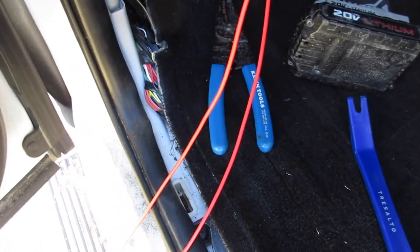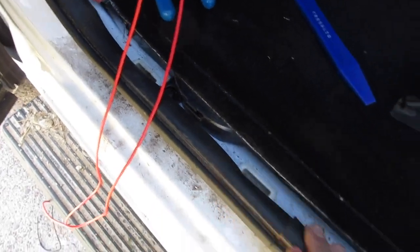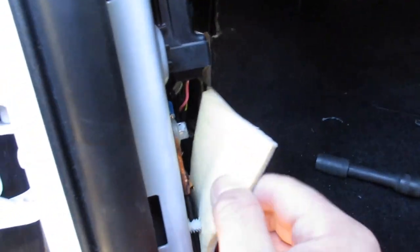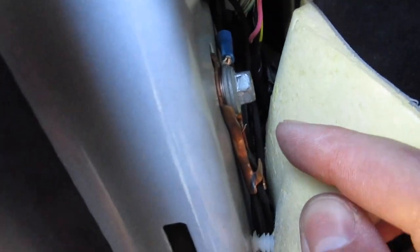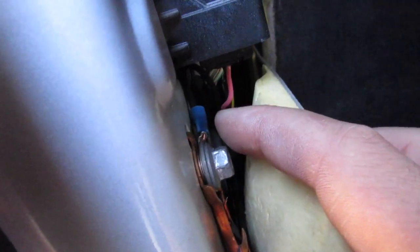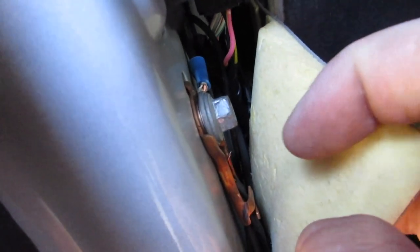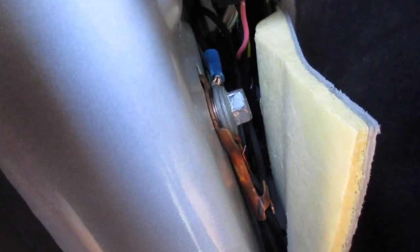Something I always like to do is, when you get real close around these wiring harnesses, sometimes under this plastic is hidden grounds. I just so happened to find one because I've never taken this plastic off. Right here is actually a stock ground that already has a nice bolt and washers there. So what I went ahead and did is tied the negative — you can see that blue right there, that is my negative wire. I put a little circular ring connector on, and it bolts right on, so now my negative is done. It's zip tied right there to the stock wiring harness, so it is virtually invisible.